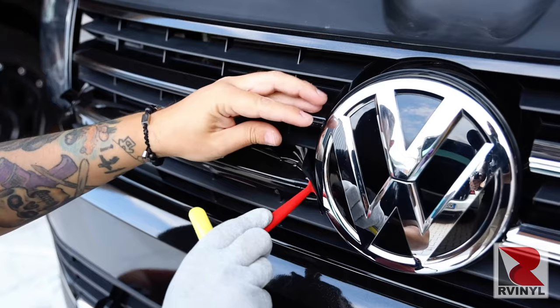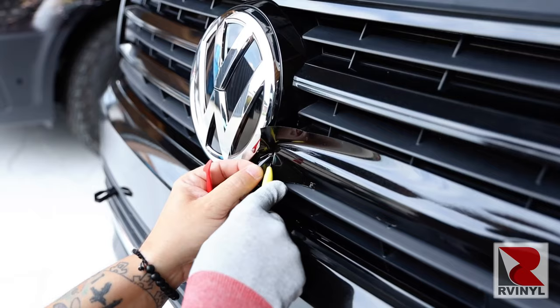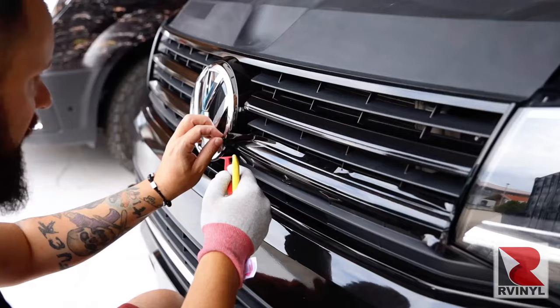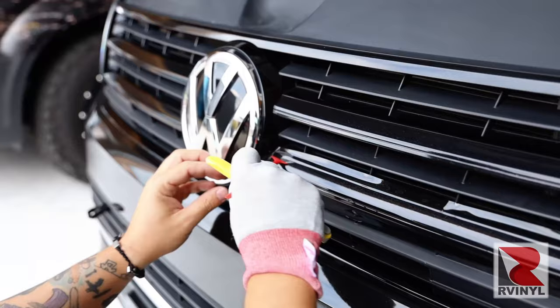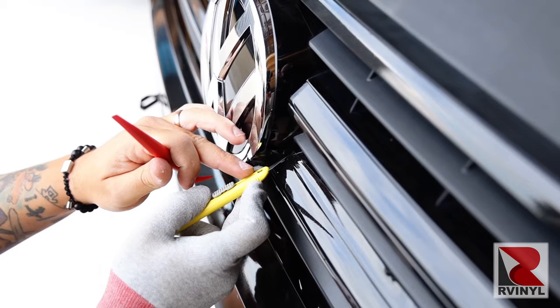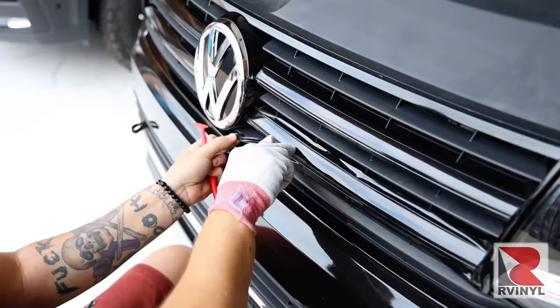Another modification: on this side the emblem is sticking out very far, which again keeps the material from getting all the way to the surface. A relief cut is made, but instead of doing it all in one shot, the material is cut, tucked to the edge, picked up away from the emblem, tucked in again, and then cut safely away to the edge of the emblem. By working in stages you get full coverage with no tension on the main portion of the grille. A good tip is to always do these raised areas first, then do the flat middle sections last — this will help create a nice solid workflow.